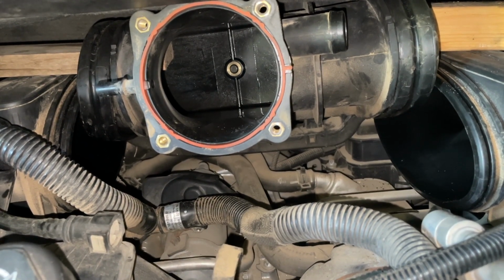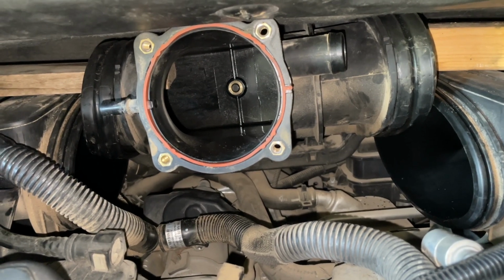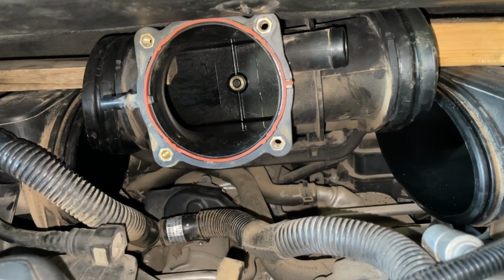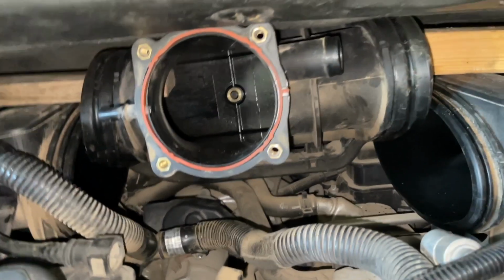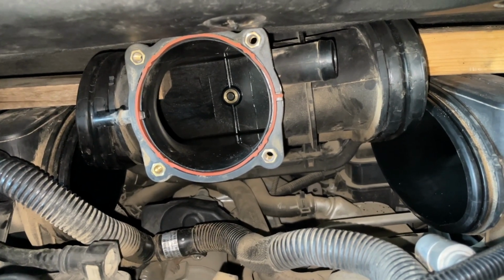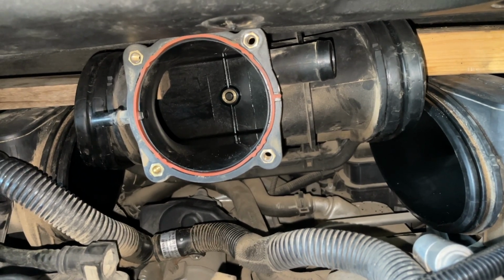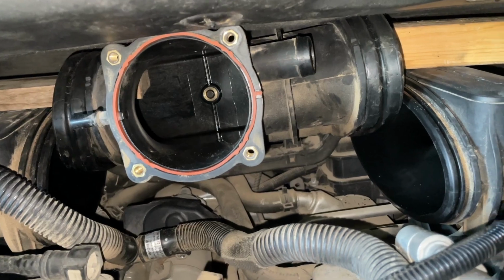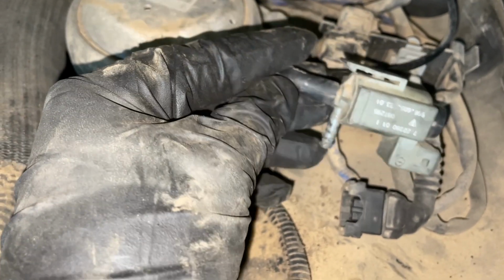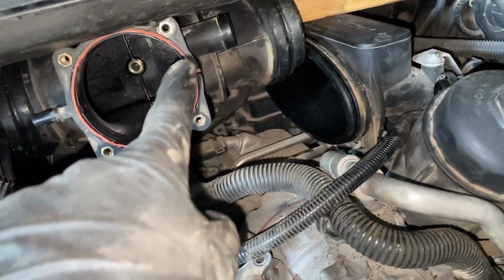This is an S model, and that means it has an additional vacuum seal on the back. I'm going to put a link below down in the description to Pelican Parts, to a video that they have, video instructions, because on the very back side of this, there is a vacuum controlled valve, and to get that loose, you've got to be able to separate that vacuum line, basically the hard line from the soft line, or like we did over here, you need to separate the soft line from the end of the changeover valve. Basically, it's the same kind of changeover valve on the back side of the plenum.